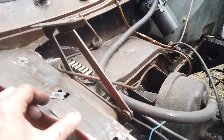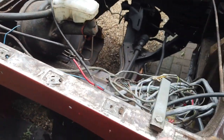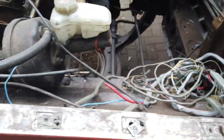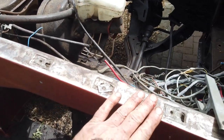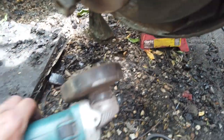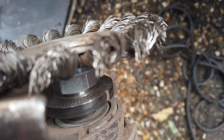We've got a metal plate that needs to go in here - see that hole. But we're good on the top so we're going to treat this with the Dinitrol rust converter. A little plate to go in there - about the size of a five-pence piece. Then we rust-treat this. I've ground it back with a wire wheel - pretty powerful wire wheel. Those type of zip wheels are good. Eye protection - those little strands can fly off and embed in the eyeball. Zip wheel - everybody, very good.